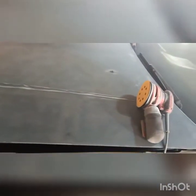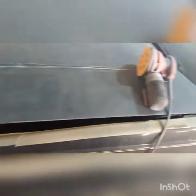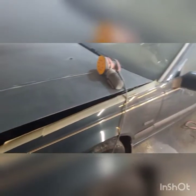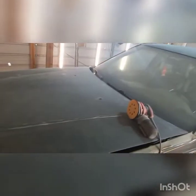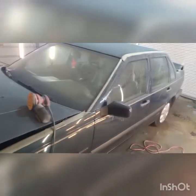And then I think from the way it's looking already, it's gonna be smooth enough so we don't have to do nothing else but just go ahead and tape off the whole car. And then get the primer. Let the primer set 24 hours. That's what I'm planning on doing. And then I'm gonna try to get the primer on by tomorrow if I can. And then I get it sprayed and cleared Wednesday because of the weather. We're supposed to have 50-some degrees on Wednesday. So that's what I'm looking for. Cause anything less than that, I'm not even trying to mess with it. Cause see, when it's 50 out there, I can easily get the shop to 65 and 67 degrees, kind of easy. But man, when it's 19 and 20, man, I ain't messing with that.